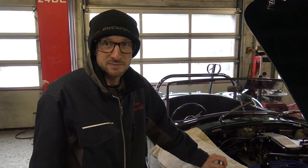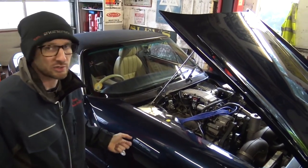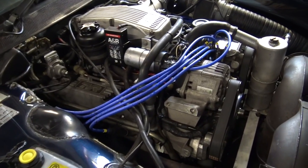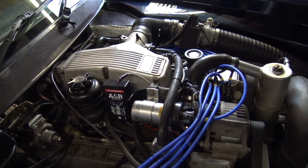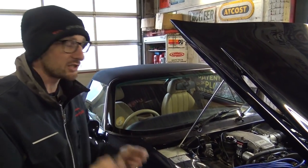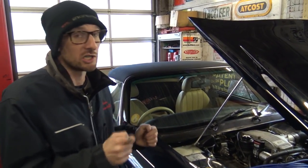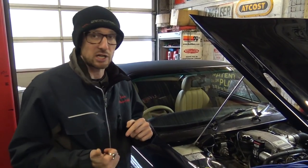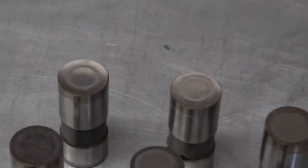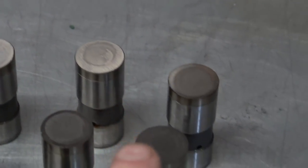On to the TVR. Steve's just confirmed it's ready for road tests, so we'll go up the road in this in a minute. As I said, it came in at about 90,000 miles. We know Mobil 1 oil is generally used in TVRs, which is far too thin for these engines and causes premature cam wear. This car has actually been maintained incredibly well with religious oil changes, and it did switch over to 20/50 at some stage. So the camshaft was actually in really good condition for a TVR at 90,000 miles. Steve will splice in a little bit of video showing the concaveness and where the surface has started to wear off on the tappets, with some finger pointing so you can see that.